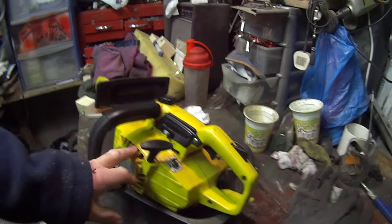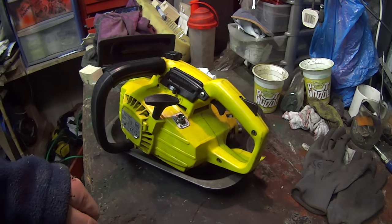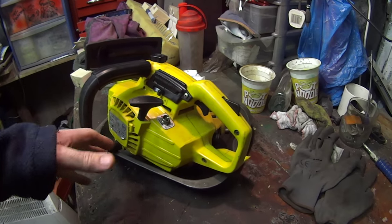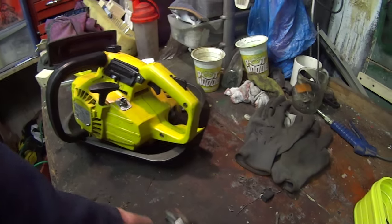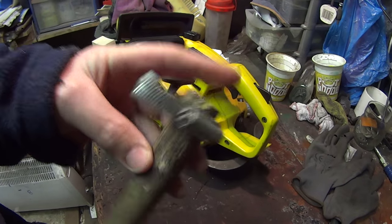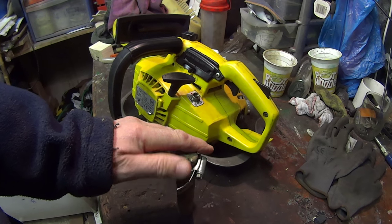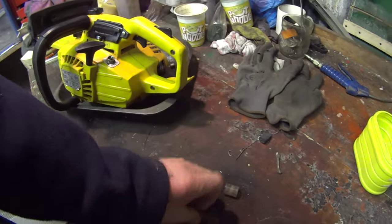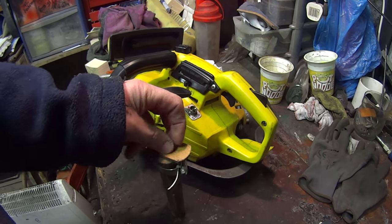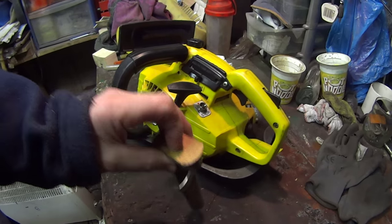If you do take the pulley out, make sure you hold the plastic cover onto the spring with a screwdriver or something, before you take the pulley out with the rope on. I didn't, and if that spring comes out, it's a devil to get back in. The only way I could do it was with this. It's just a bit of wood with a hole drilled in it for the spring end to go in. Wrap it round. The Jubilee clip holds the bottom side of the spring where you're wrapping it. When you've done it, you want a bit of wood that you can screw on there while you're doing it, that holds the top of the spring just across. Then once you've got it together, you've room to get a few tie wraps.